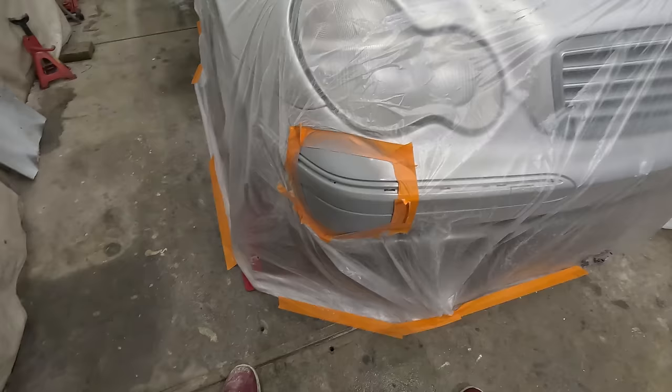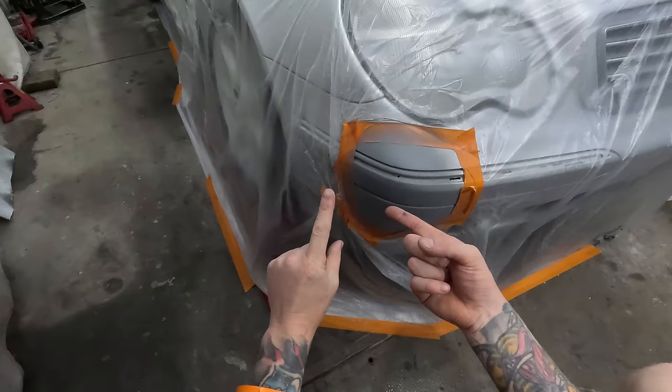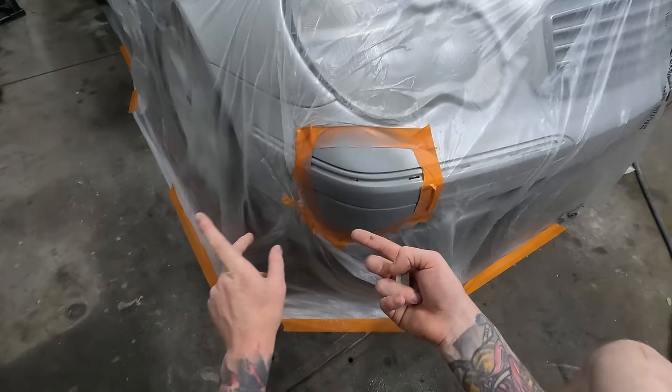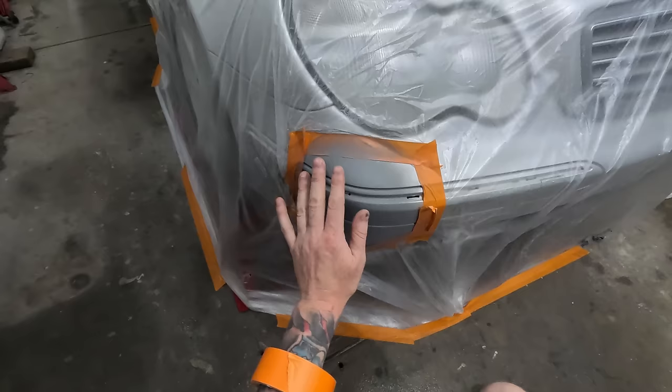So yeah, I've been doing spot repairs for quite some time now, and I definitely didn't always do them the same. What I would have previously always done is primed it up like that. Well, I would have used 2-pack way back in the day. Would have used 2-pack fillers, potentially a bit of 1K primer sometimes, depending on the size of the repair. I wouldn't have had the UV fillers, wouldn't have had the UV primers. I did get on the UV primers before the fillers though, so potentially I would have UV primed that at some stage.